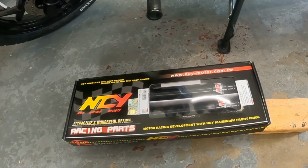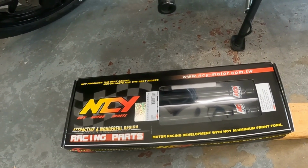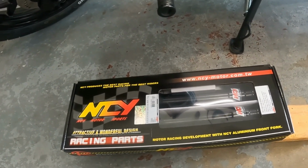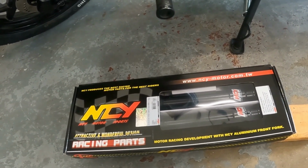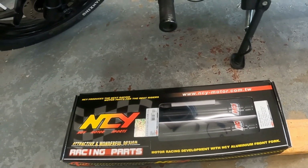The other big plus I think is it moves the trail down from 8 inches or 6 inches, I forget now, but it decreased that significantly. So the bike is going to handle better. It's going to handle better because of that sag, and it's going to handle better because of that trail. It's going to feel better, more responsive, and quicker. So that's a great deal.